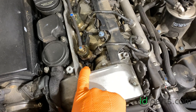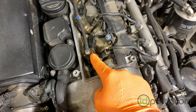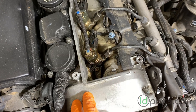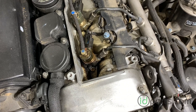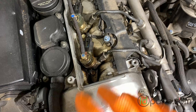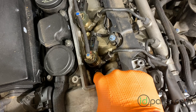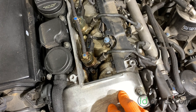What we have to do is take this injector out. It's pretty straightforward: remove the fuel line, take off the connector, remove the return line, and take off the hold-down bolt. The injector is held in by one bolt and a rocker arm with two tangs. That setup isn't great at maintaining proper torque, which is why seals fail. After removal we'll clean the bore, clean the surface, and install a new seal and a new bolt. You always need a new bolt — it's a stretch-to-yield bolt, so reusing the old one will cause the same problem again.